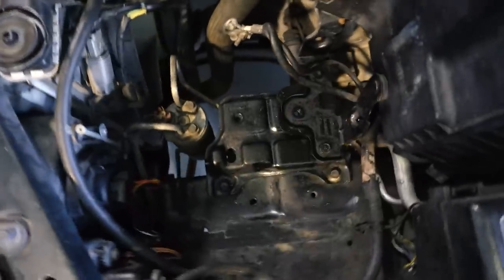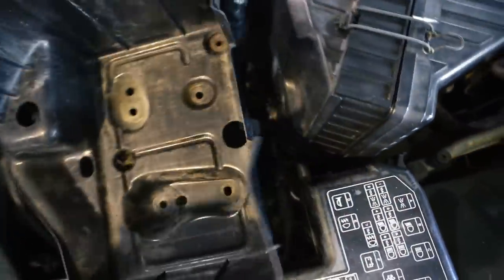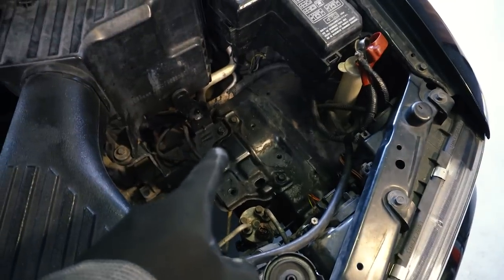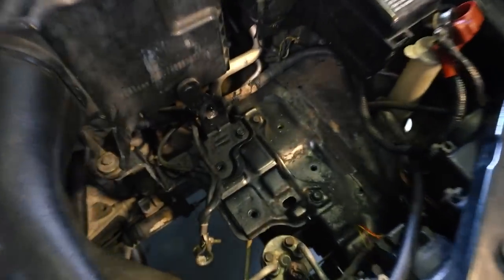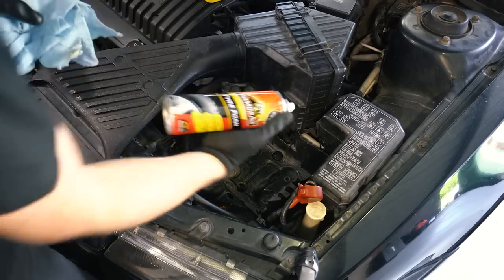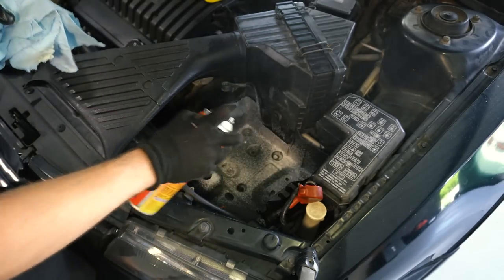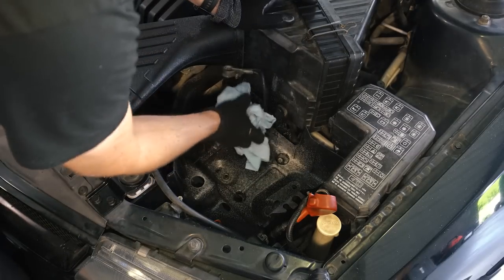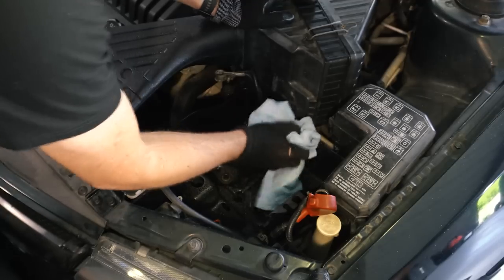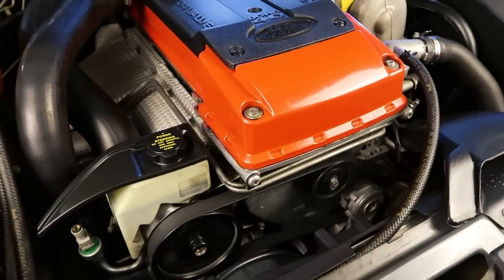Next up, I'm going to throw a Century battery in this thing because they are sponsors of the channel. I actually found a lot of surface rust under here because the battery sits in a plastic tray which goes down into the engine bay — so that is a Motoring Box top tip: the next time you check your battery, pull it out, have a look under the battery tray, and get it all nice and clean, because that is one area where rust loves to creep in. I like to use Tyre Foam to clean it up. We're actually going to use that product to give this whole engine bay a clean-up very soon. Long-time viewers would have seen me use it before on my BA Falcon XR6 Turbo's engine bay — click up here if you want to have a look. It turned out amazing and still looks good even to this day.